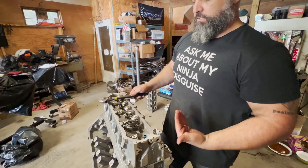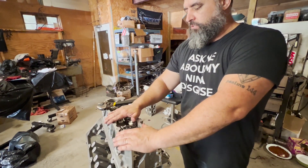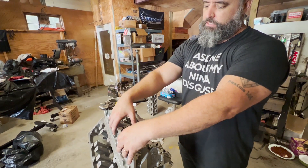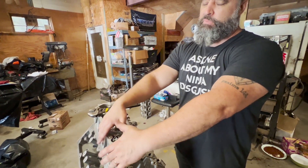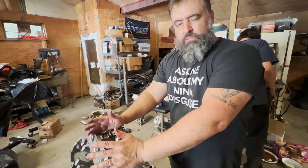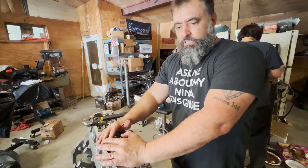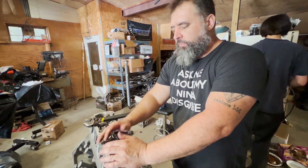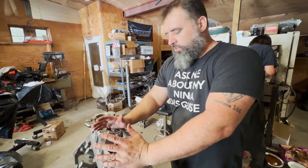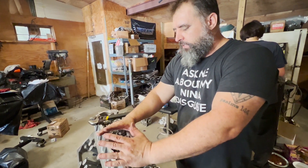Now I'm back to gaining more distance, so I'm trying to catch the pre-minimum — once it starts to chase back down. What we normally do is use a dial indicator that sits across the head. Once I find that minimum distance, I set the dial indicator tip here, push the valve down watching the dial indicator, and that gives my exact piston-to-valve clearance. There are other methods, like the clay method, but the problem is clay will compress — and if you don't have a solid lifter it's definitely gonna compress your lifter and skew your measurements.